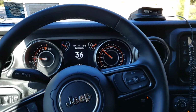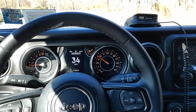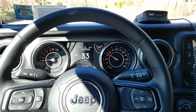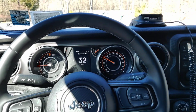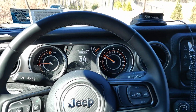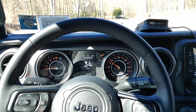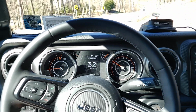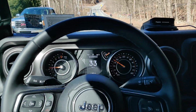So I don't know why the dampener or how it can improve it to that extent, but it seems to have done its job. I think it was 150. Took more time to get the tools out and put the truck up on ramps and the jack stands than it did to replace. It was maybe a 5-minute swap out once everything was kind of set. Very easy install, 18 millimeter bolt on each side, and it was in and out.